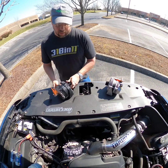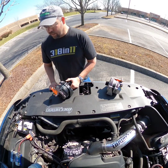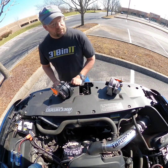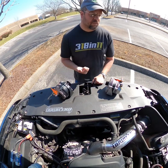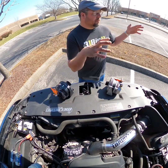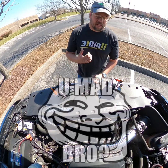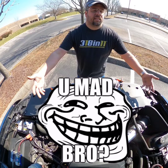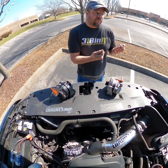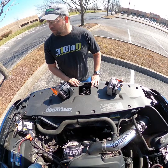I can tell you personally — I've had one of these large case units on my Jeep for probably 10 years and haven't done anything to it. Give it the right belt, proper belt grip, zero-gauge cable, and ground it right, and it is a powerhouse for winching. I've got a cheaper three or four hundred dollar winch that out-pulls guys with nicer winches because I've got the voltage foundation. I've literally had to stop pulling to let someone catch up with their more expensive winch.